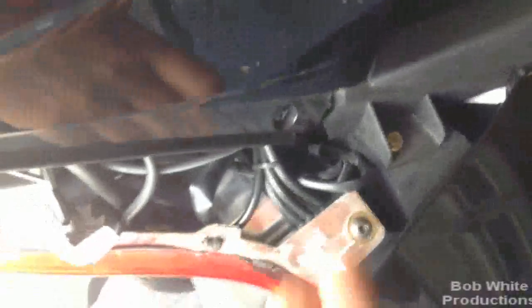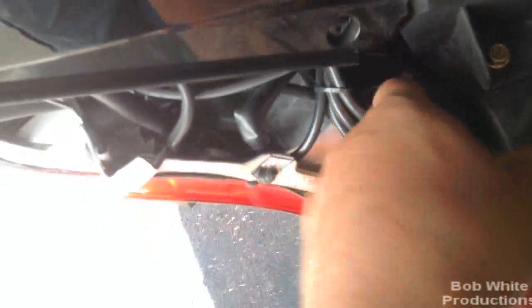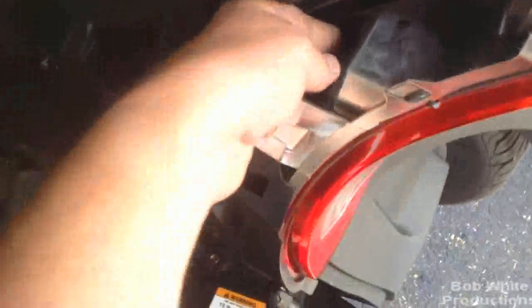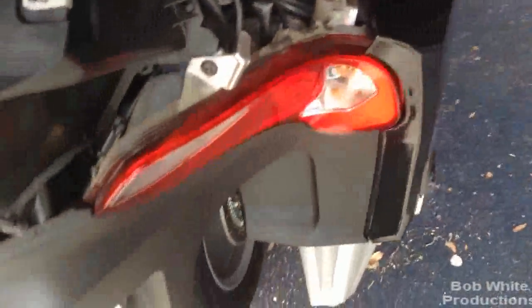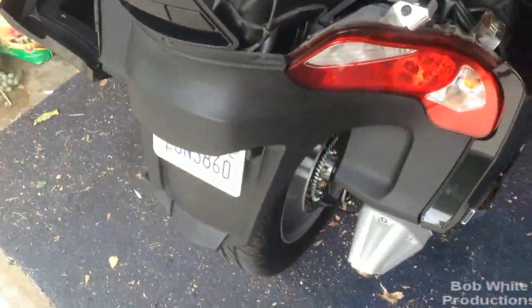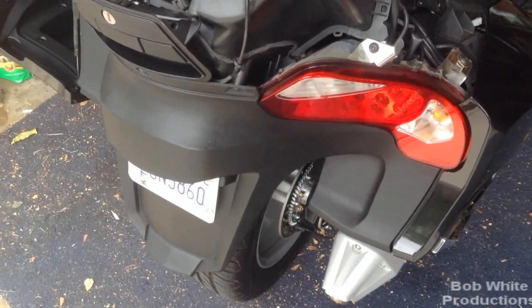So that's off. Then I thought, do I need to take anything more to get at the brake lights? I can see the harness is right here - orange and white wire - but you can't really pull it out to get at it. Same thing on the other side. This one's a little more accessible, but again there's like no slack on it to try to tap in. So it appears we need to remove this vinyl cover here, which I will do next, and I'll show you exactly what screws to remove to get at the brake light wires. Stay tuned, more to come.